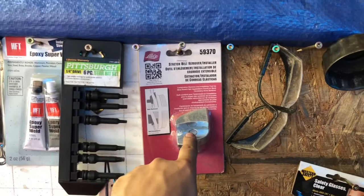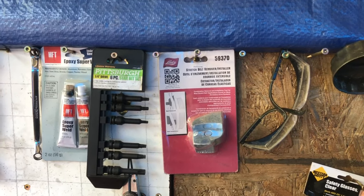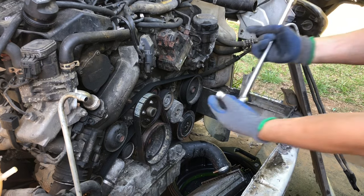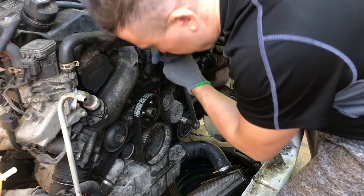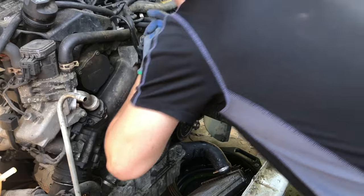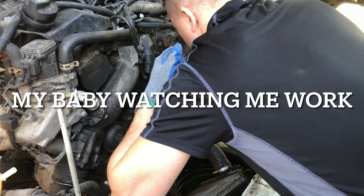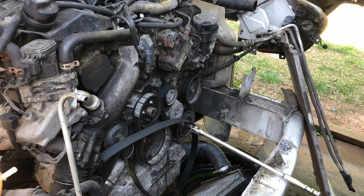To install the little belt you'll need a tool like this that grabs it and installs it. To remove the belt, here's what you gotta do: you gotta get a 17-millimeter, remove the tension from the belt — that's the way you detension it — then go ahead and find a place to lock it. Just like that — we have removed the belt.